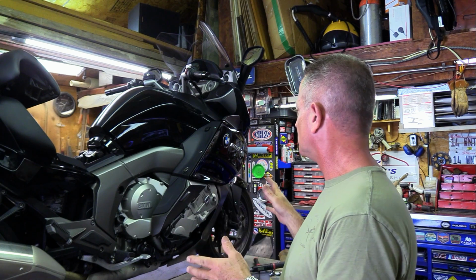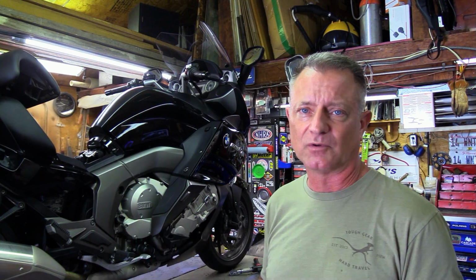But this bike hasn't been ridden in years, I think before 2020 or something. I think the plates on it were 2020. So it's definitely been some years since this bike has been running. And anytime I've noticed that these K1600s sit around, they have a problem with the fuel pump. Now, I've gone over the fuel pump video before on how to change out the fuel pump, or sometimes you can knock it a little bit and it will come back to life.